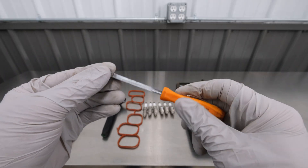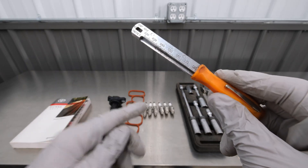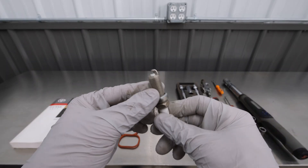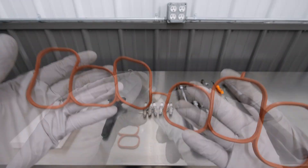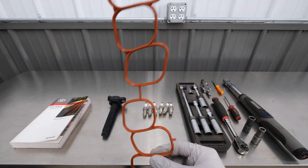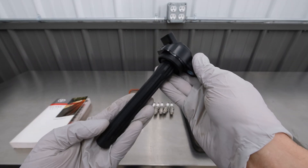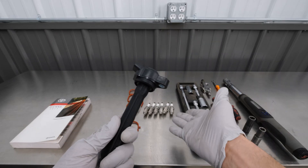This vehicle uses iridium spark plugs, so the spark plug gap tool isn't necessarily needed because they come pre-gapped and you really don't want to damage the tip. However, if you have a copper plug or anything of that sort, sometimes you will need to re-gap them. The vehicle I'm changing spark plugs on is a 2017 Toyota Sienna van. We also have an intake plenum that goes over the top of the back cylinder head that needs to be removed, and I'm replacing one ignition coil in the back because that one is acting up and the vehicle was misfiring.